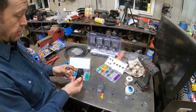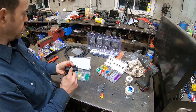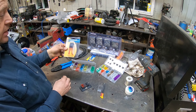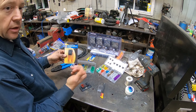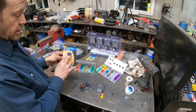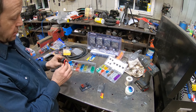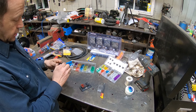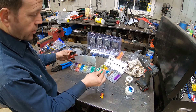This is where the main bus bar is going to come in. I also have this inline fuse setup that I'm going to use because I don't want to blow anything on the UTV side — I want this to blow before anything else happens. I might be a little too prudent but it never kills anything. 30 amps.